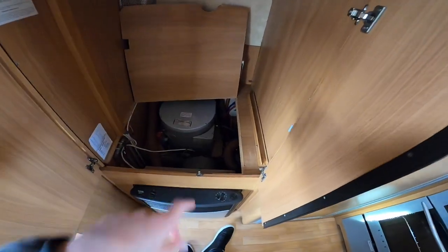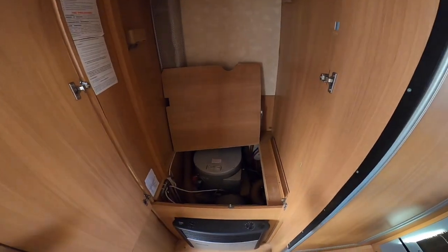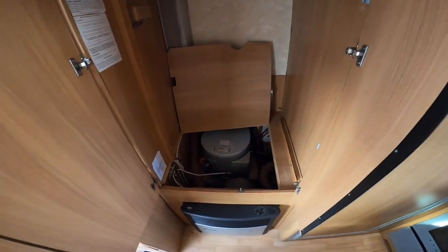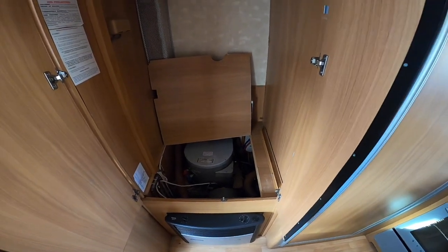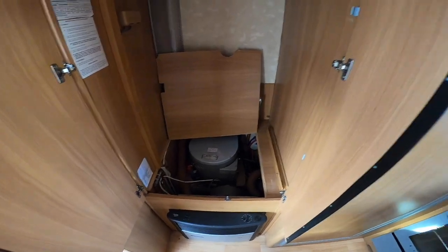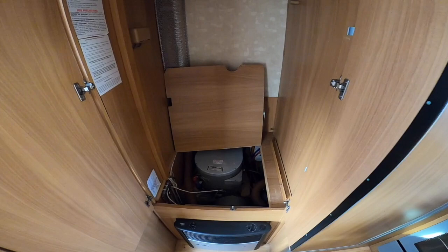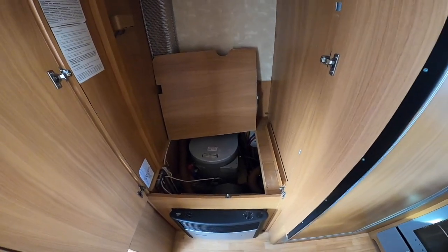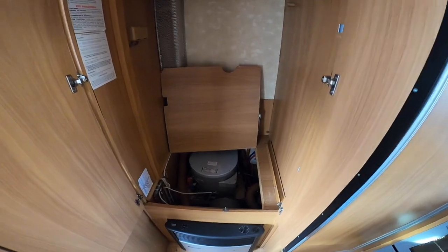Once you've opened the boiler, you drain off the fresh tank, open the waste from outside, and then leave all the taps within the motorhome open, as well as the shower head. You'd remove that and lie the hose in the shower tray with the mixer tap open. This will stop any water coiling up in pipes behind furniture and wallboard, and it'll allow the air to not sit in the pipes and cause an airlock.